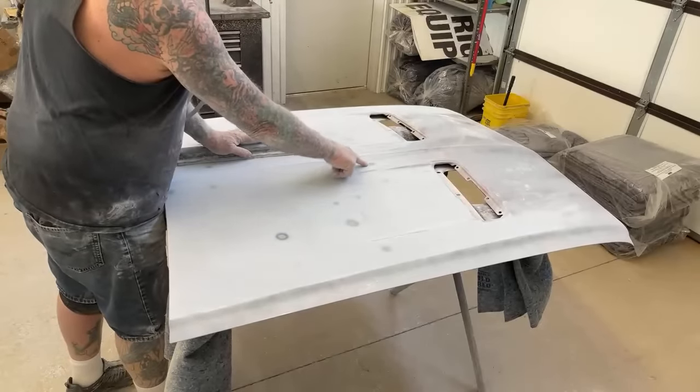That feels better, but I can feel that I'm still going to have to add more into it. So what we've done: we went ahead and applied our bondo - our body filler - to our primer, and it adhered to it very well. I will repeat my process on all of the dents that I missed until I get them right. But the real trick is prepping the primer so you can actually apply the filler. By using the 36 grit, it gave us the opportunity to get a grip of what we need done to do the job right.